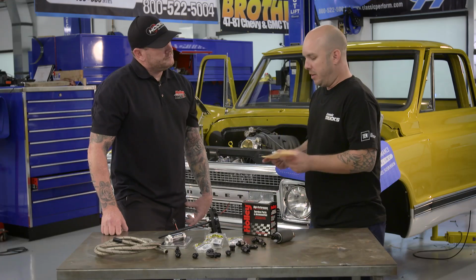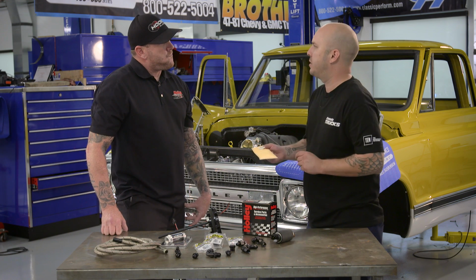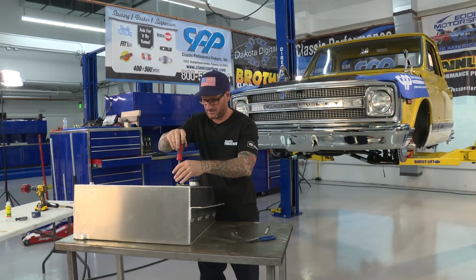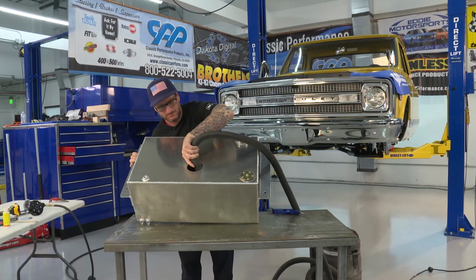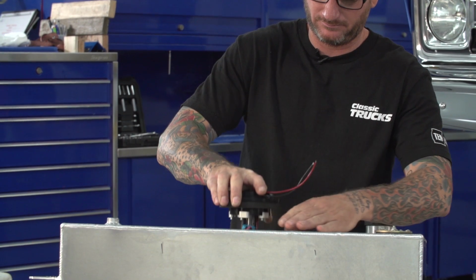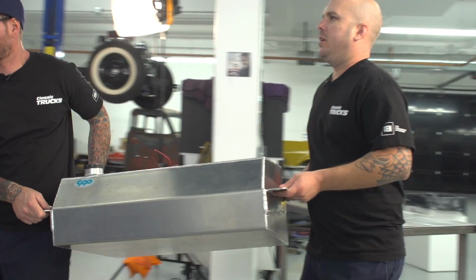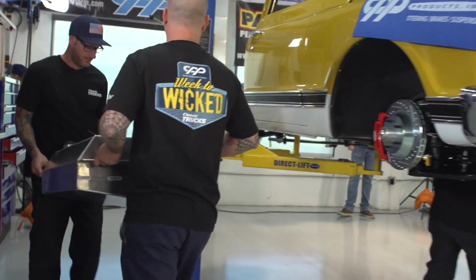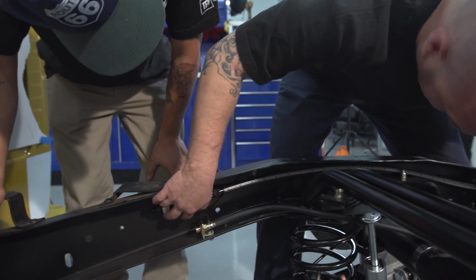That's very cool, Ricky. Now, I know they use these in a bunch of different sanctioning bodies and racing, ARCA and some other things. How are they utilizing this for what they need? That's right, Ryan. We actually had the ARCA guys test the first design of this mat for us. That's a situation with those race cars where they have to maximize every ounce of fuel that's in the fuel cell. They end up using very complicated, very expensive fuel systems where they have fuel pumps in the corner of every tank, what we call lift pumps, and then foam and baffles. By moving to a Hydromat type design, they are able to remove all of those fuel pumps, get that savings, put a Hydromat in there, and still use every drop of fuel that's in the fuel cell. That thing spans the whole bottom of the tank and picks every last drop up.